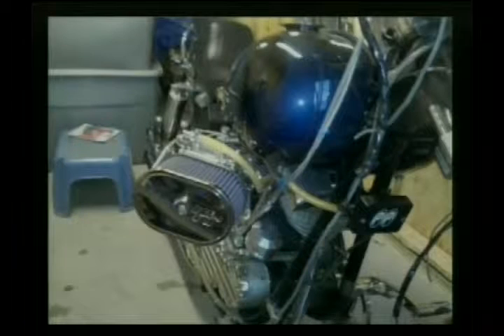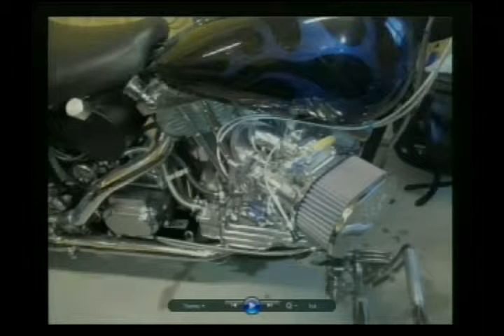Let's go to the next shot. I routed the throttle cables, and these were actually kind of nice. These are S&S push-pull throttles I got off eBay — 58-inch long cables, because they've got to come all the way down from those ape hangers, wrap underneath the tank, and flip around the backside since the cables come in the backside of this dual-throat carb. They swing around and come around on the other side — you made a Nike swoosh in there. Exactly. I just zip-tied them to the fuel line for now and they seem to be sitting pretty.